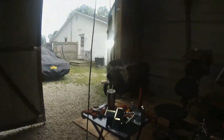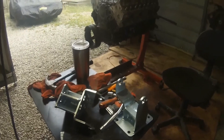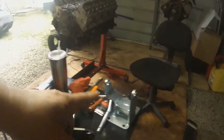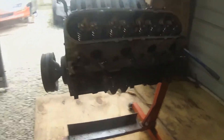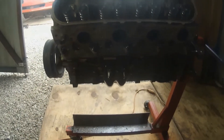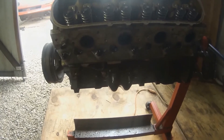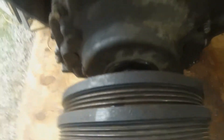These are the motor mounts I'm going to use on my crossmember. These are going to change it to pretty much an LS crossmember, but you've got to have the steering rack because the LT1 won't clear those motor mounts. I bought the F-body motor mounts that go on the block — they only fit one way. Let's throw some of these parts on it. Greased it up and pushed it up on there.